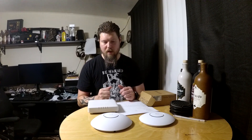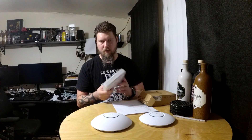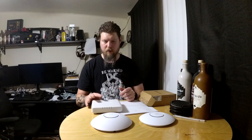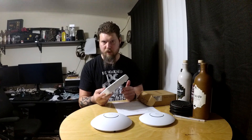The other cool thing about the Ruckus R600: being enterprise grade, back in the day you had to buy a wireless controller with a license on both the access point and the controller — and in the enterprise world, licenses cost more than the hardware. But you can also put standalone firmware on it for free. They now have this new 'Unleashed' firmware, which we'll cover in the next video. It acts almost like Ubiquiti UniFi — single pane of glass for all your access points. One AP becomes the master, and you log into it to see all others. It's super easy to configure, performs better than a UniFi environment, and still has more enterprise features.